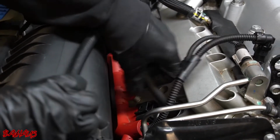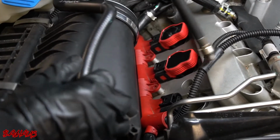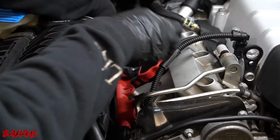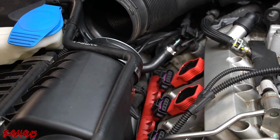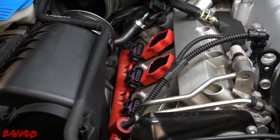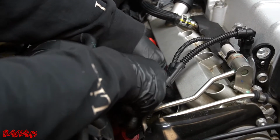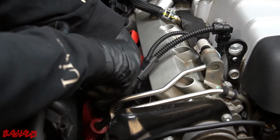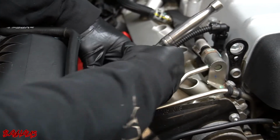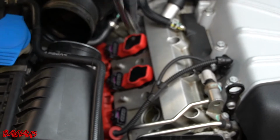We're going to put our spark plug and our coil back into cylinder 1. We're going to remove our cylinder 2 spark plug and coil and insert our compression tester. So cylinder 1 spark plug back into cylinder 1. Spark plug tool on the spark plug, tightening it up. I like to just do it by hand, it's a lot easier. And then tighten it fully with the wrench. Cylinder 1 coil pack.